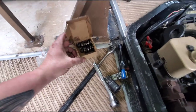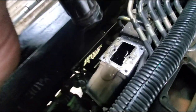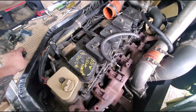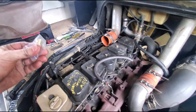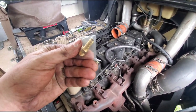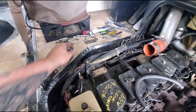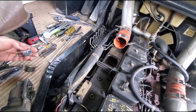Got the governor springs changed — there are the two old ones with the 4K springs. I left them out. You can see the spring down in there with the keeper on top — that slotted keeper. There are two of them, 180 degrees apart. Changed those, and now it revs higher because it gives fuel up higher. The only way you control a diesel is fuel — no spark, just fuel, timing, and boost. Now I've got to change this nipple, grind the edge off the washer on the smoke screw to get a little more out of it, and put that fuel plate in.